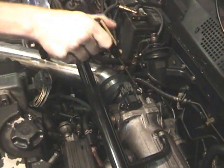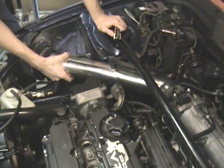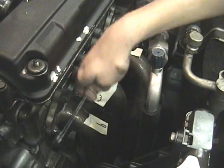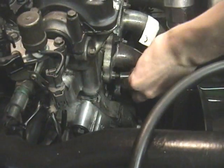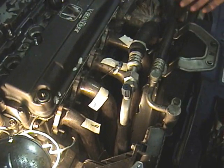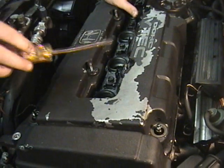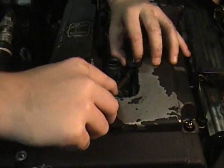Also, unscrew the air intake tube. After you loosen it up there, just take the air intake tube off. There's nine twelve-millimeter nuts on the manifold — just break all of them and take them off using a wrench or any other tool. Once you've unscrewed the nine twelve-millimeter screws, you're gonna remove the exhaust manifold after you pop off these washers. I already took off four, but there's four more. If it's hard to get off, just cinch in the screwdriver. Make sure it doesn't pop off and get lost.